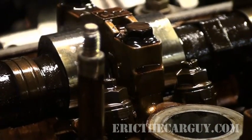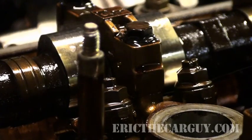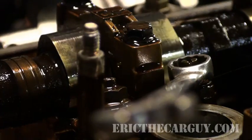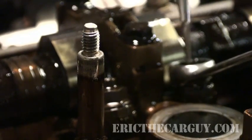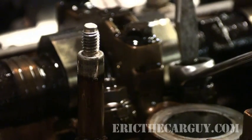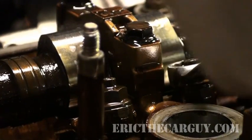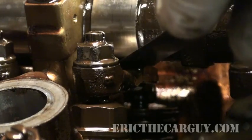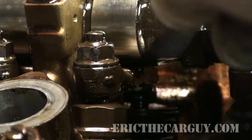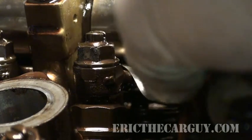Now that you have your valves all ready to be adjusted, be sure to have the correct size feeler gauge — in this case they're intakes. If you're using the screwdriver and wrench method, put the wrench on, hold it still, and knock it loose. Spin the adjustment screw until it just bottoms out, then hold the screw in place and tighten it up. I'm looking for just a little bit of drag as I pull the feeler gauge out. See how there's just ever so much resistance? That is a properly adjusted valve — a little bit of drag.